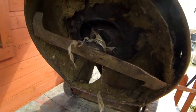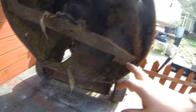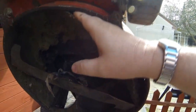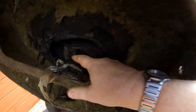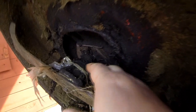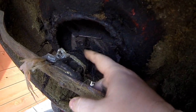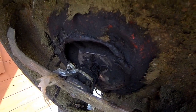You can see we've got some stuff wrapped right around the boss there, which is obviously slowing it down. There's lots of old grass here which I'm going to have to pull out. I'm going to dig all this out and pick it off because it's actually tight around the boss and that's why the motor runs very, very slow and comes to a standstill. This is all old string and stuff — you've got to get all that off, so I'm going to have to cut it off.